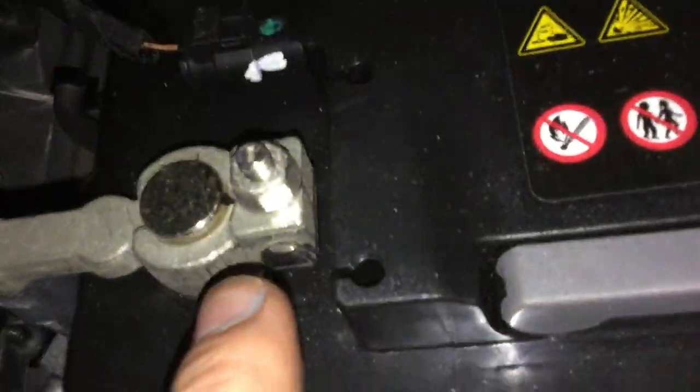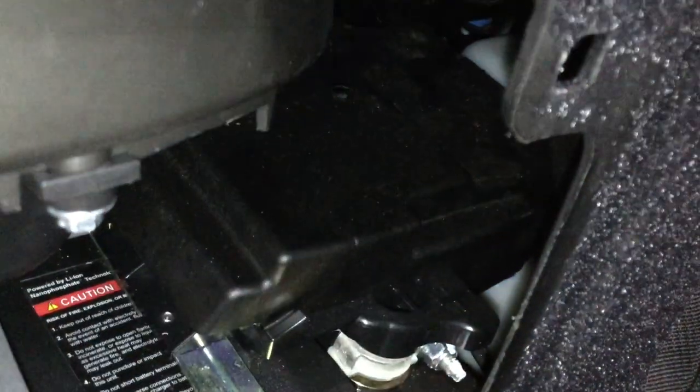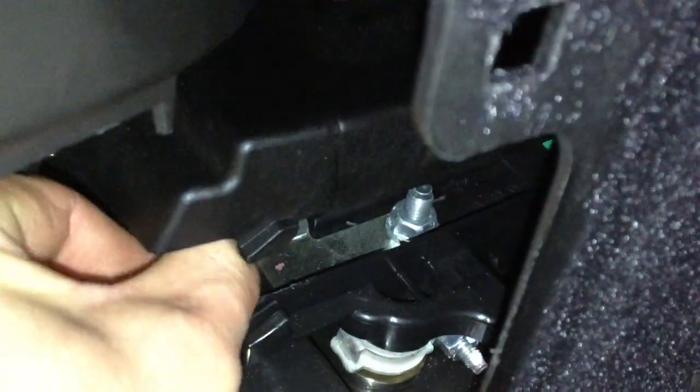Here is your negative terminal for your battery. Your positive terminal is covered underneath this cover here. To release this cover, you'll have two clips located around the back there which you'll have to push inwards, then push the cover up towards the passenger side and lift it up. Push your hand in, lift the clips up, then push the trim up and away. Just enough so you can access the positive terminal. If it isn't at the right angle, give it a little tweak — bend it upwards a little if you have to — just to make it easier to get your jump pack on there.